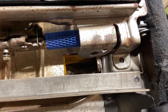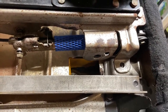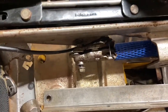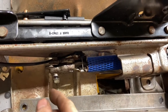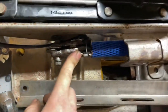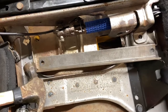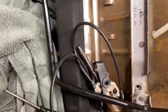So instead of going out spending $300 to $1,000, I just used a 79 cent bolt that I've been holding on to probably for the last 6 years or so, and then it basically just bolts on right here, which it was not fully bolted on before, which is why it wouldn't stay up. And then I'm gonna put this nut on here and tighten it up, and then that's gonna hold the spring that allows it to recline back and forth. The seat will work again like it used to when it was new. Just know that. And then once I put the spring on, and this other little attachment on, we'll put the seat belt,